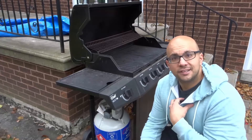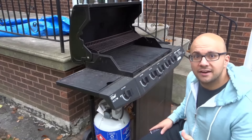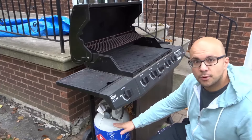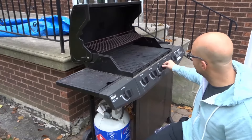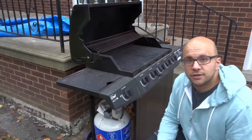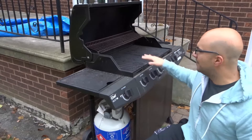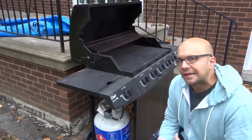It's a safety feature, and if you're like me, sometimes you might accidentally activate that device. What can activate it is this: I usually turn on the grill knob first, then turn on the propane tank, and then light the grill. That's just how I thought to do it, but it can activate that device — it thinks there's too much propane going out, so it thinks there's a leak and limits the propane. Your barbecue won't reach higher than about 200 to 250 degrees; you get a very low flame.